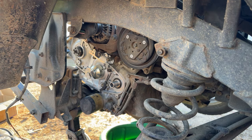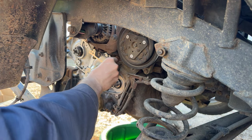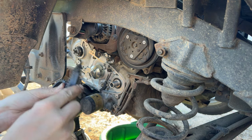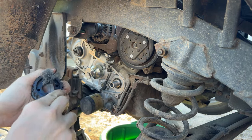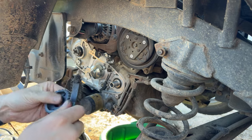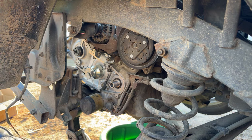And then we've got this one that goes right here, perfection. And then we got this one that goes over here. And then we got this long boy over here that goes in that corner, but we're going to have to cut it down because it grew a quarter inch. So yeah, we'll go ahead and get the seal puller and get that next. Right after I clean up some of the crud on this crank sprocket. A lot of build up and crap down here. Just knock it loose with the brush and then hit it with brake parts cleaner. Finish it off.